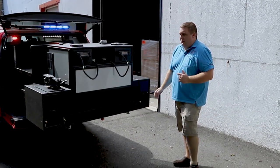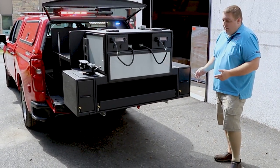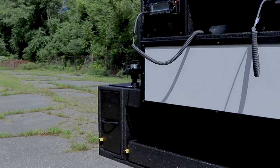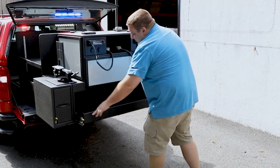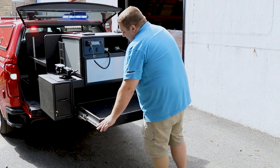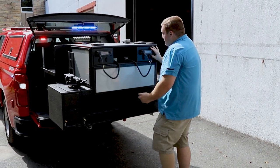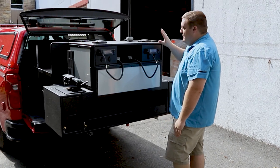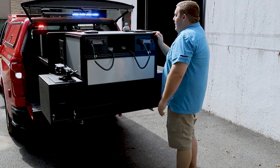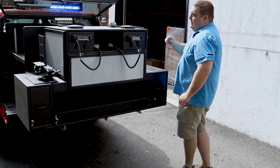Taking a look at the cabinet with it extended, you can see it's a little different than what's normally done. We needed to add file drawers onto the cabinet. This is designed for their Case Commander incident command case, so it pulls out and the hatch flips open so they can use it in the back of the vehicle. We gave them an additional whiteboard surface along with two radios, a 12-volt USB, controls to override the scene lights and rear warning lights, a storage compartment, radio heads, speakers for the radios, and a 110 outlet.